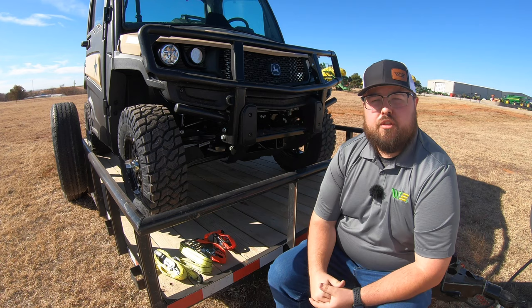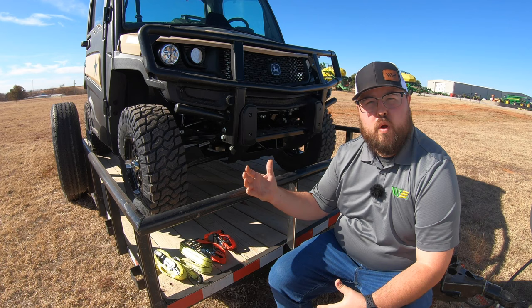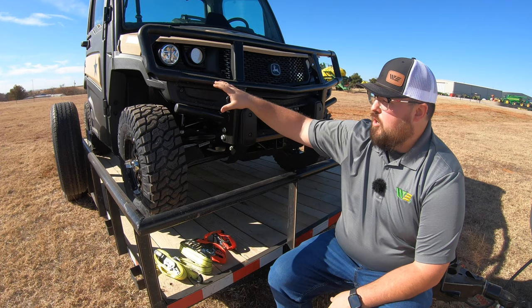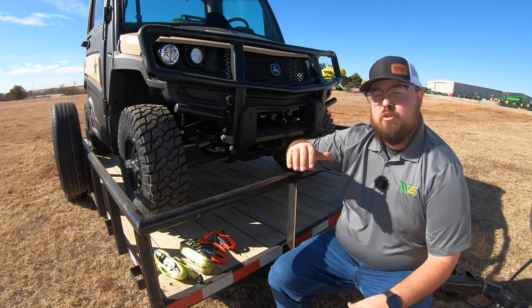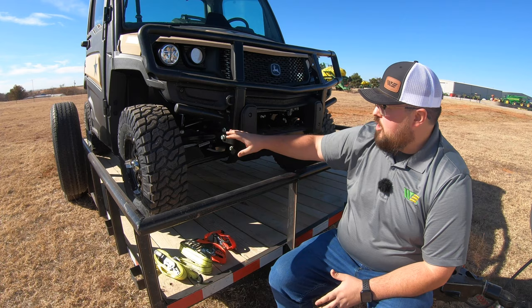The reason I didn't pull the machine all the way up to the rub rail is because then we're putting too much weight on the tongue of the trailer, putting too much force and stress on the back of our pickup. That's where we might get into situations where our pickup is squatting, which will cause a much bumpier ride at the rear. And of course, we also don't want the machine too far back, or we'll get into fishtail situations. That's why the 70/30 rule is so important — avoid that common mistake.